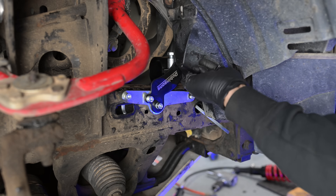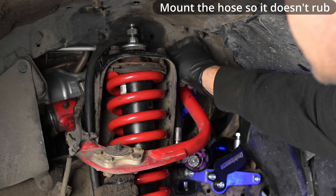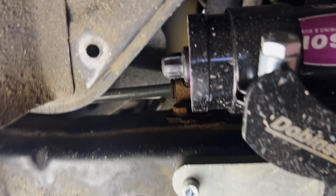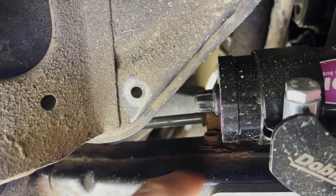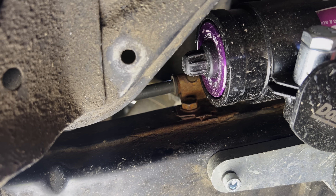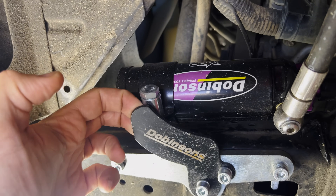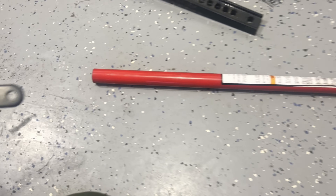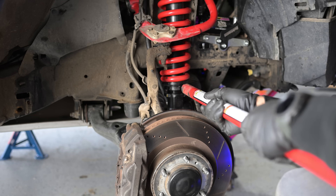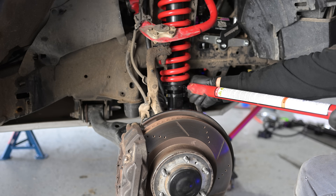This is the reason why you may want to get those aftermarket reservoir holders. The correct routing for the reservoir hose comes up from the bottom and goes over the shock tower, all within the upper control arm. For the driver's side, to get the reservoir on you're going to remove the mount for this HVAC line — basically take this mount off, flatten it up, flip it around so it pushes the HVAC line in towards the vehicle, then remount it. Pull on the bracket that holds the reservoir more towards the wheel. My ride height was a bit higher than I wanted — I had too much preload on the coil so I had to back off on it using a cheater bar with the included tool.